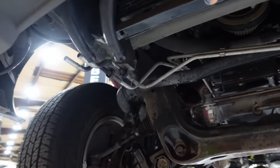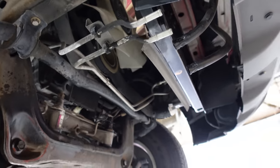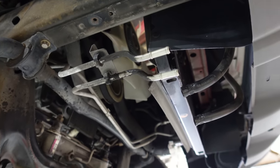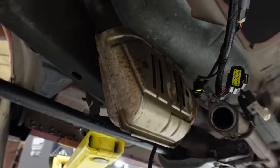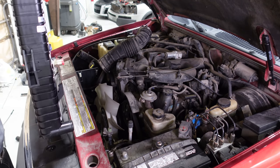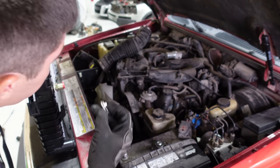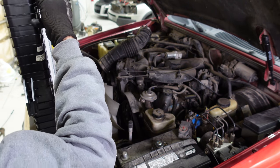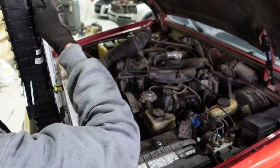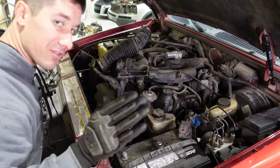The transmission cooling system is nice and clean now. We are ready to start putting everything back together. I can hook up the external cooler back to the lines where it tees through the radiator, and we can finally put the radiator in and get this thing back together. It took a lot of flushing to actually get the system clean, but the end result was crystal clear fluid, and that is obviously what we want. The lower radiator hose is on, which means it's time to install the actual radiator. You do need to install these clips that hold the fan shroud to the radiator — those just slide in on each side. You might have to do a little prying or wiggling to get those to seat. If you took the fan shroud out, make sure it goes back in now before the radiator.